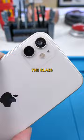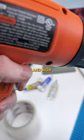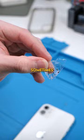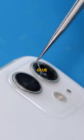I'm actually not even going to open this phone up for this repair because the glass is still intact. I'm going to place some professional — not scotch — tape on the camera, and now we're going to heat everything up. The tape prevents that glass from touching the camera lens, because sometimes it can be impossible to remove. Now we have the glass removed.